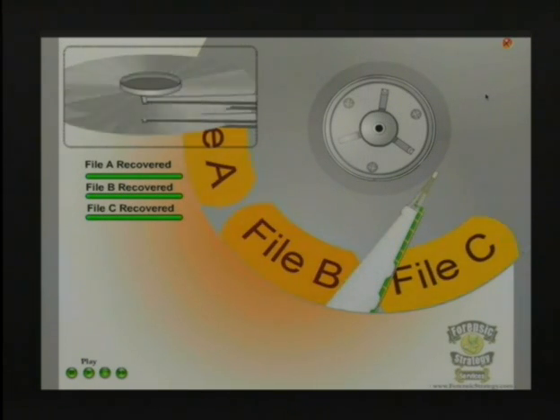It doesn't matter what OS you're using. If you're imaging a drive and doing a DD, it doesn't matter if you're using Windows to read a Linux drive or Linux to read a Mac drive. Most of the recovery programs out there try to read a drive as if the OS mounted it. That's kind of a bad approach because if it's scanning the drive and moving around or skipping around on the platters, it may be causing more damage and you may use up the one or two good attempts you have left to get that data back.